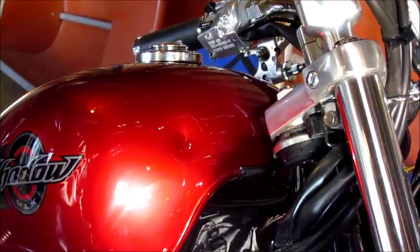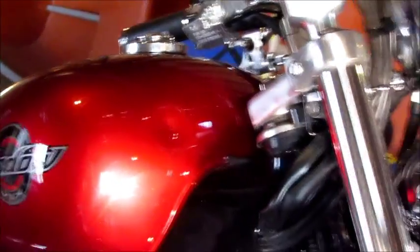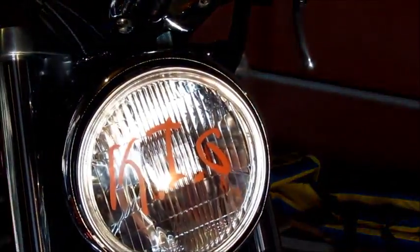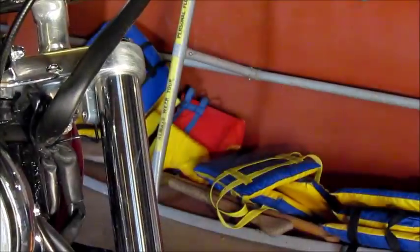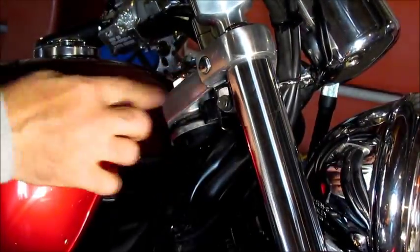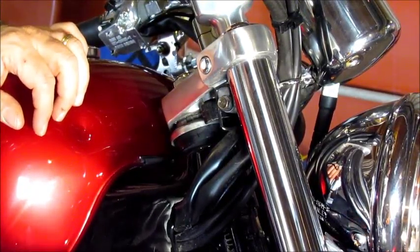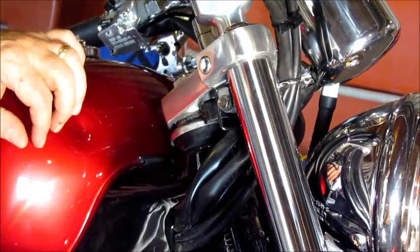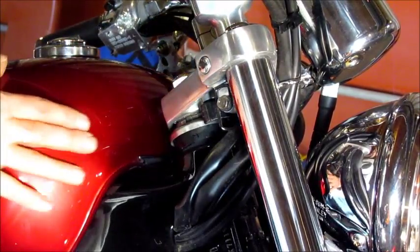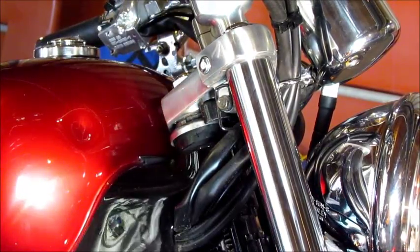Here's what we're looking at: there's a dent right here that appears to have been caused as the fork rotated around during whatever caused the wreck. This section of the fork banged into the tank, and it looks like that was allowed to happen because as the fork banged into the bottom part of the stem it bent a little there. We're going to try to fix that next.